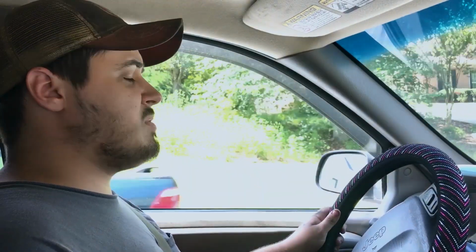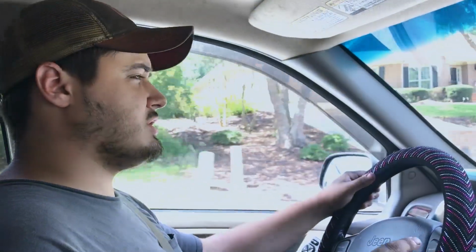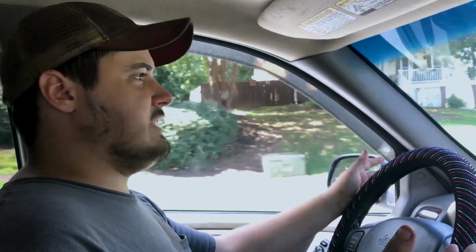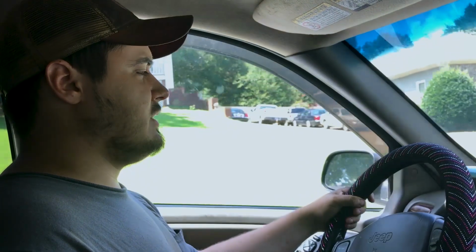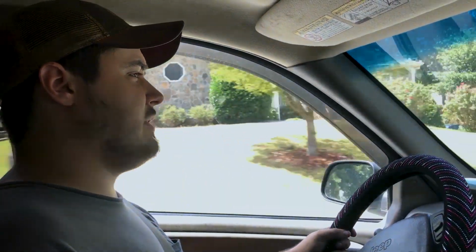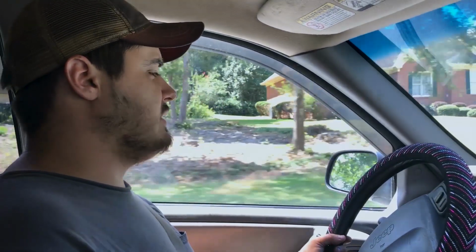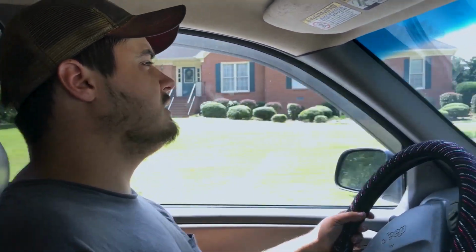All right, now on your test drive, you want to be really gentle after you've done transmission work. Don't gun it, because if you gun it, you're going to break stuff. So here's first gear, here's second gear. 200,000 mile Chrysler. I expected it to be a little bit of a hard shift, but that was a little ridiculous. So you want to just drive it real easy, go slow.